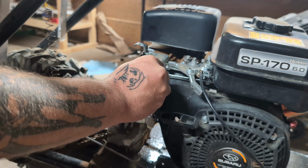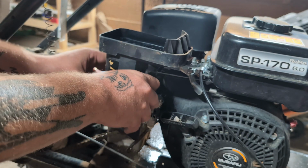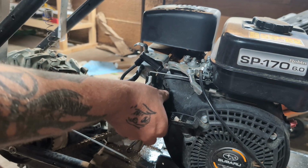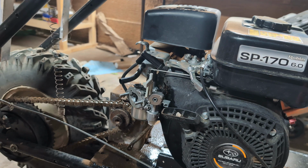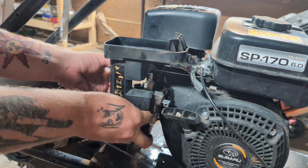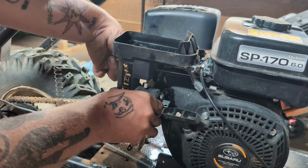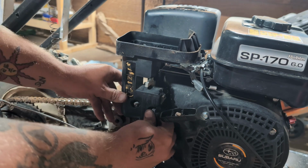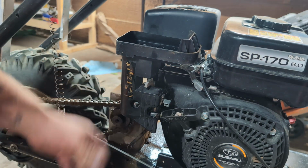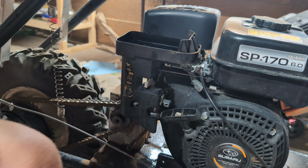And we put the choke back on. Now we just could set it back up. Let me make sure everything is on the up and up. Let's turn the fuel to the on position for a second. Make sure it's not leaking any gas. Doesn't seem to be. Now when I'm putting this back on, I'm feeling behind and putting that little thing back in. It's cool, you actually don't, it doesn't matter which position the on or off switch for the fuel is when you put this back on. Let me get my tin.